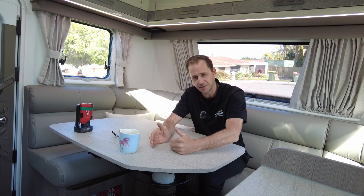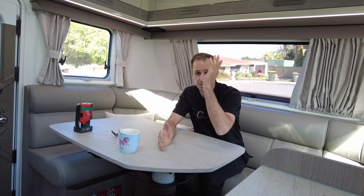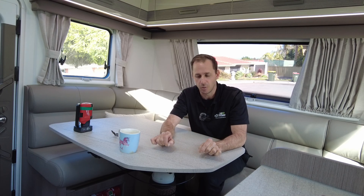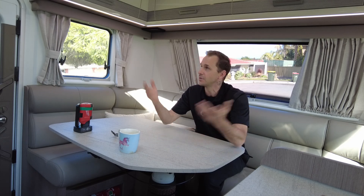Another thing I should touch on with these drop-in lithium batteries: when you over-discharge them, what happens is the battery shuts down. The BMS will sense full depletion — all of that discharge is gone, you've used up all the capacity — and what does it do? Turns off. Quite literally. The FETs and MOSFETs on the BMS will shut down and kill the power to the terminals. You will have pretty much zero voltage on those terminals. Anything connected to those batteries will show nothing — voltmeter, battery monitor, lights — all off. So for all you guys that have experienced a BMS shutdown: you'll go to bed at 13.2V because you don't have a proper battery monitor, and you'll wake up and everything's off. That's a low voltage shutdown from the BMS. It's supposed to do that — it's designed to do that.